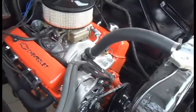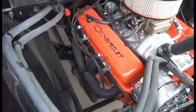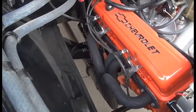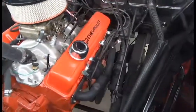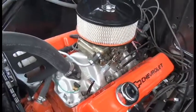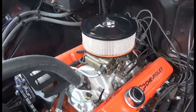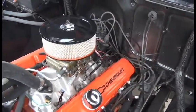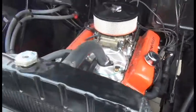It's a little dusty, but when I did have to get it running the compression tests were good, so we just threw some new valve covers on it to clean it up a bit. The headers that were in there drop down very low just to pass under the crossmember where the tranny sits — maybe we'll change that out one of these days. Put a new intake manifold on; the one before was a racing one, which didn't make much sense. This one is more sensible — it's just a 350, probably from the 80s, but it performs well enough.